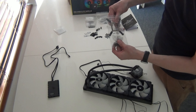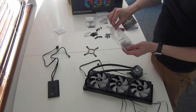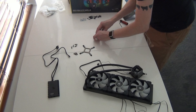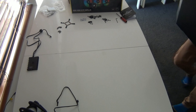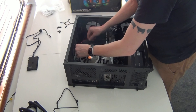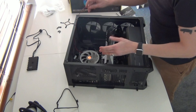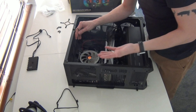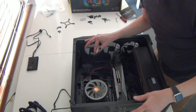Next we're getting the components ready to mount this into the computer. This is the CPU mounting plate for an Intel chipset — we'll be using that one with the corresponding screws. Now we're taking the old CPU fan off and getting ready to put the new assembly in place. The old fan had two cables: one for RGB lights on the fan itself, which was never connected, and a three-pin cable directly to the motherboard that powered the fan and controlled its speed.